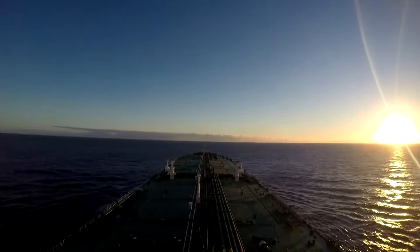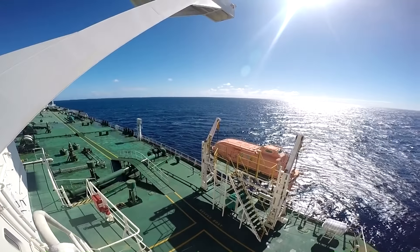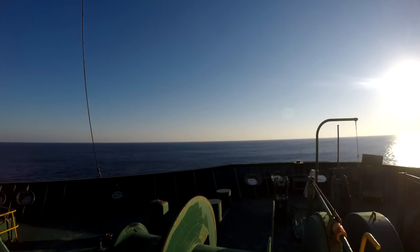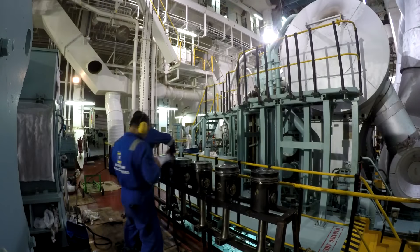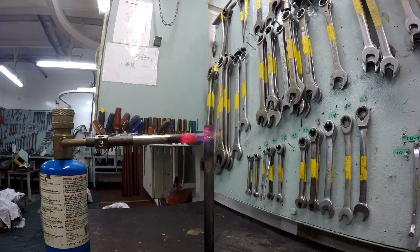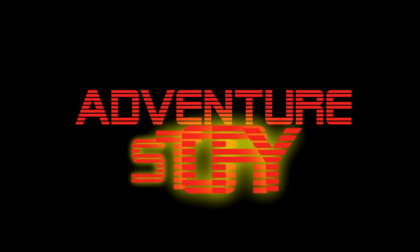The measurements you will see today include: measurement of piston ring groove clearances, piston ring side clearances, piston pin and bush measurements, big end bore measurement, big end bearing measurement, cylinder liner measurement, timing gear, tappet guide measurement, valve and guide measurement, guide pin yoke, and intake and exhaust valve measurements.